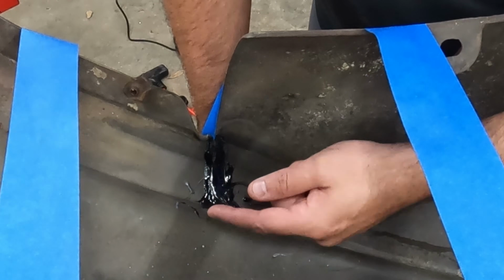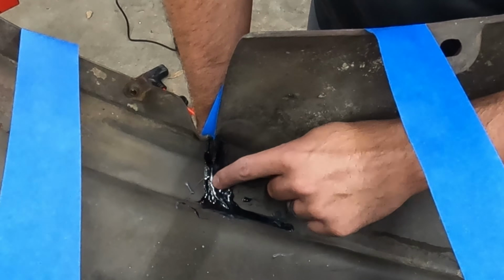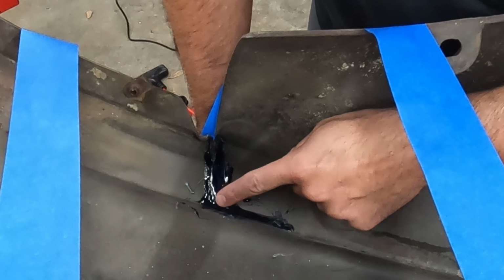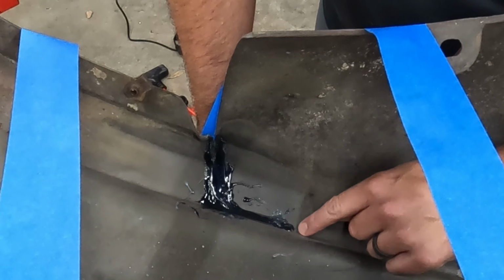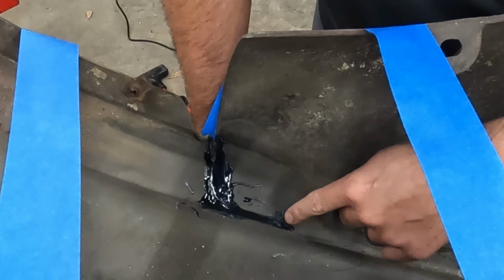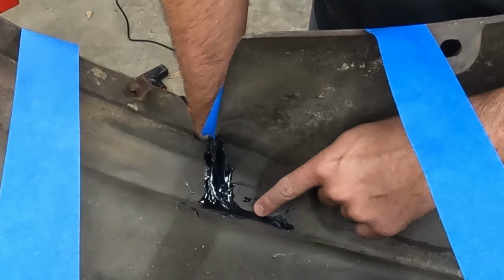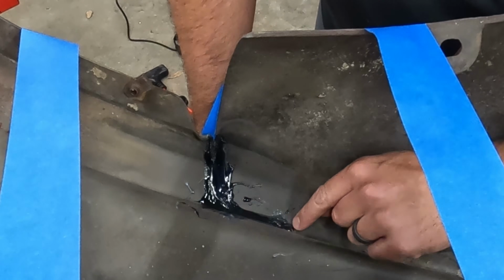Get you a little closer here, but I don't know what you'll be able to see. But you can see there's a lot of gray here. Gray lines here, there's a gray line right there. And when I put this in, it was very runny and it ran down this line, and it did not do that on the other side. So it was too runny. It was not mixed good enough. And you can see a lot of gray in here.